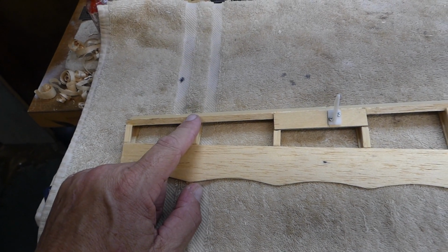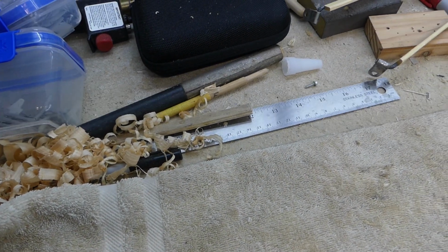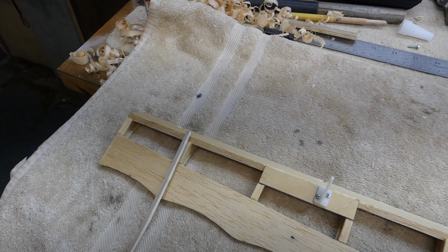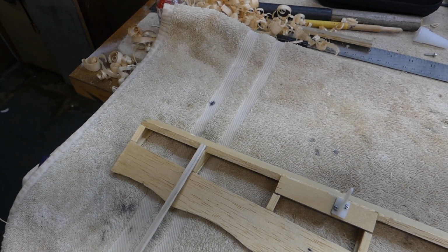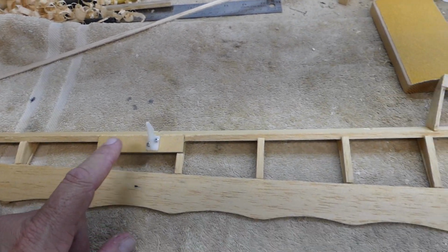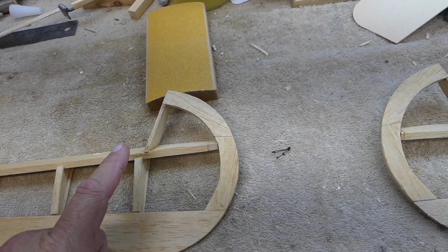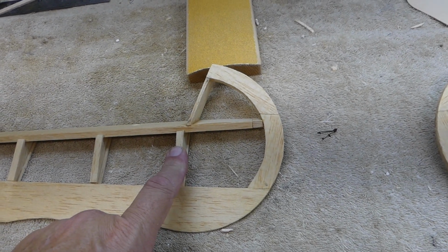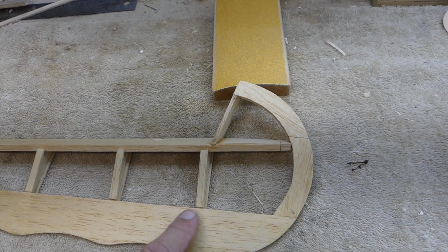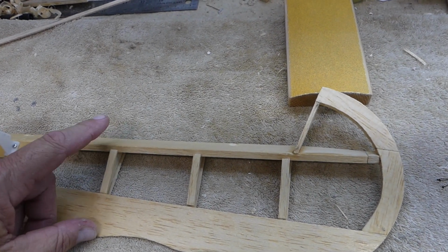And it might be easier for me just to get some rib material and go ahead, if I don't knock everything over. I don't know if I got, might just be better off to come in, this isn't wide enough. I'll rip out some more rib caps, and I think I'm just going to replace every single one of these things, because it's not going to take that much time to get them off if I even wanted to. I just have to get them close to being completely removed, because I could just put something on top of it and then we'll get everything sanded so that it's flush the way it's supposed to be, up against the rear edge and properly angled for the leading edge.